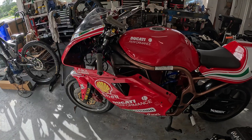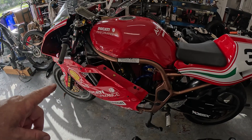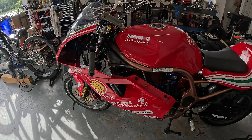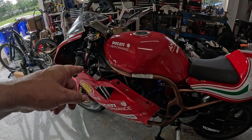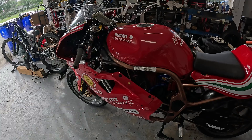Shout out from Florida. I want to upgrade my battery in the fake Ducati and see if it's like a motor upgrade. It doesn't have quite the power I want. I've got it at 600 amps and I'm barely getting 600 amps out of that ND1200 controller. If I upgrade the battery, maybe I'll need a controller upgrade also. But if the battery acts like the motor and I can get more power out of a bigger battery, I want to do it.